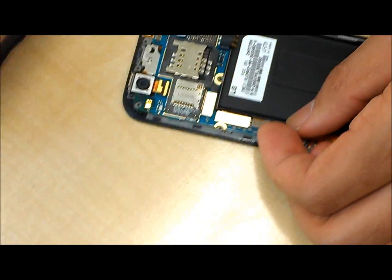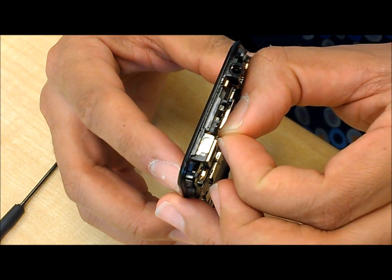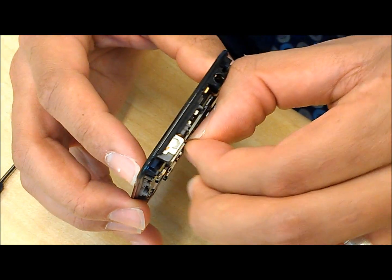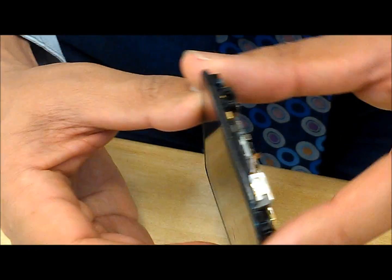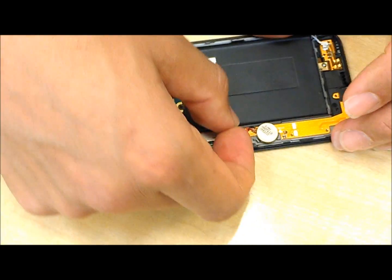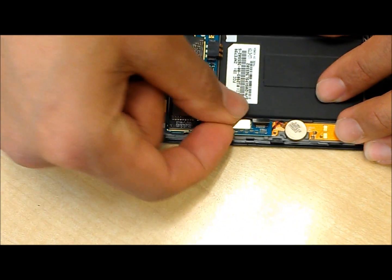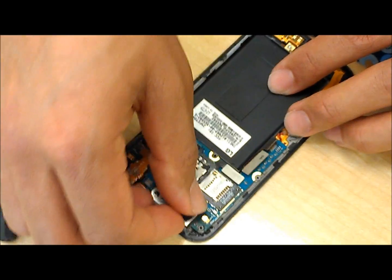That's what broke. If that wasn't already broken I would just have folded it over. Also that's flexible, so if you do buy another power button, note the route of that ribbon right there. Just gently pull it up — this will just pry off, it's just kind of pressed in. I'm not taking off the front touch plate of the phone because she's sending this back to get a new one. Take off that one, take off that one, and take off the one for the camera.